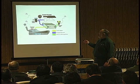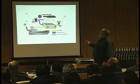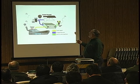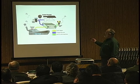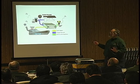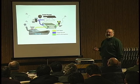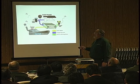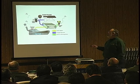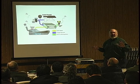We allow a little bit of vacuum through and into the canister, which sucks up all the vapor that's inside the canister. And this line, which is hooked up to the canister, has a pressure sensor. I forgot to mention that's what happens when we decide to purge the system. The pressure sensor tells the computer whether we see vacuum. If it doesn't see that we're getting any vacuum, it sets a large leak code. If it shows that we are getting vacuum, then it'll wait to see if it holds vacuum.